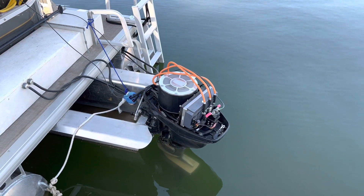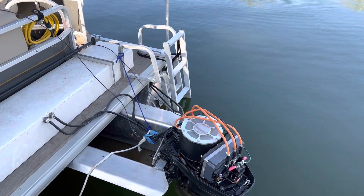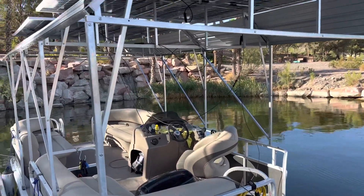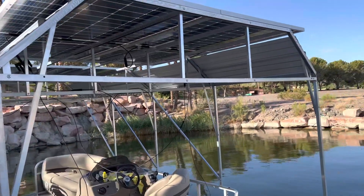Under this white box is a single module from a Tesla Model 3 — about 20 kilowatt-hours, again 96 volts. That's 60-horsepower equivalent; it's really only a little under 50 horsepower electrically speaking, but due to the instant torque it does perform better than an equally rated gas motor.